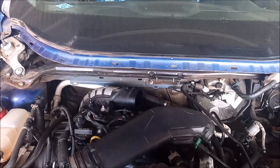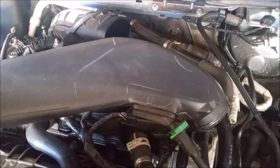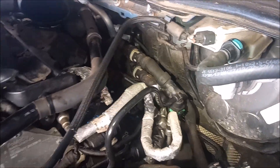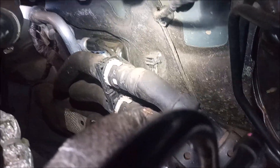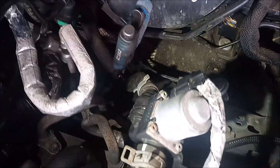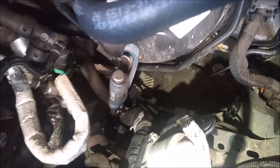To get down here, we started by removing both wipers, then we removed the wiper cowl cover, then we removed the wiper cowl. This is all pretty straightforward — just a few nuts and bolts to turn. Then we removed the air intake tube, the air box with the air filter, and also the battery and battery enclosure. With all this out of the way, we can get to where the three-way hose fits into the temperature sensor neck, where it goes to the heater core, and where it hooks into the solenoid. To minimize coolant spillage, I've clamped this hose with a locking plier before I disconnect it, and then after I disconnect it, I'm going to try to feed it into an empty coolant bottle.